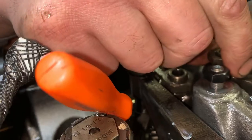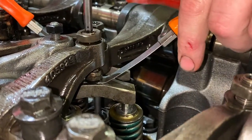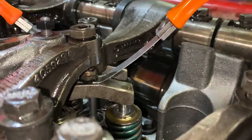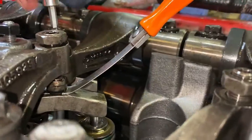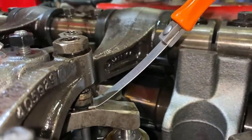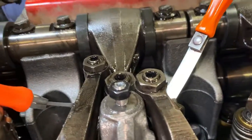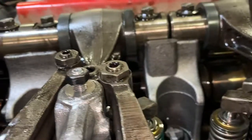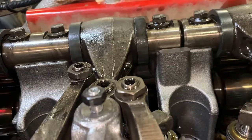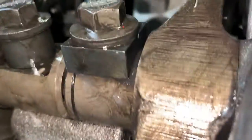This fellow uses the same procedure on every cylinder so he doesn't forget anything. He also paint-marks the nuts when he's done, and goes back and checks all the nuts before he's done. If you leave a nut loose on the overhead it can be bad news. You'll notice those shoes that are between the rocker arm and the lever — those are balls and sockets and should never come apart. If they do, you've got to replace them. When we do the valves, we snug them down because that way we push any oil film out and get a much more consistent set. The more accurate your valves are, the better the engine will idle, because at idle you don't have that great of an airflow exchange since you don't have turbo boost helping you. Consistent valve and injector sets are one of the things that help the engine idle smooth. With a computer, the computer can make up for a lot of mechanic error, but you still want that setting right and you still want to double-check all your nuts when you're done.